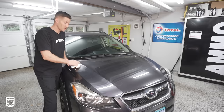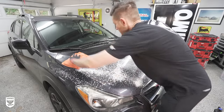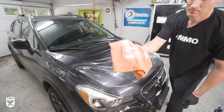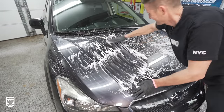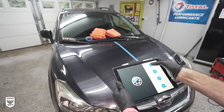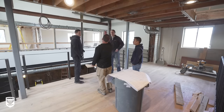Hand polishing actually works quite well and I think you guys are going to like the results. Step one is to clean the surface of the paint. Because I'm demonstrating the technique on the hood, I'm quickly cleaning the surface with Ammo Frothy and a microfiber towel. Once most of the heavy junk is removed, I quickly clayed the paint using another round of Frothy as the lubricant. I've started to document all the cars I'm working on in a Rolodex-style file system on my iPad, since I'm juggling so many conversations, videos, and construction schedules.